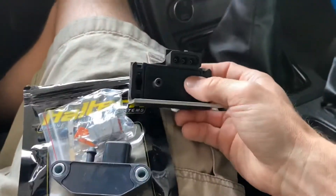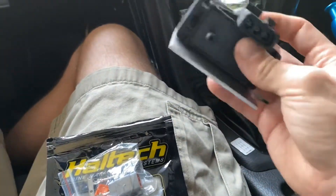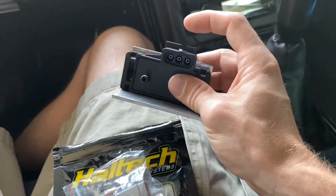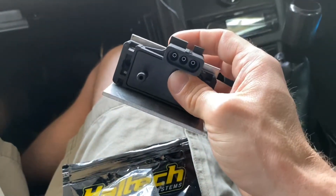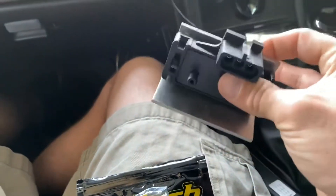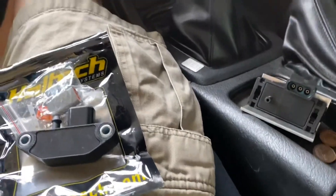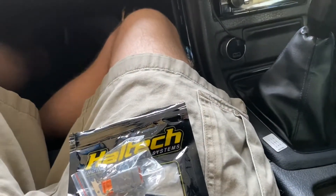What I'm going from is just a standard GM 4-bar MAP sensor. A little bit of backstory on why I'm doing this replacement: since I've gone to the single turbo, we went MAP over MAF, and I had a MAP sensor failure but I couldn't quite figure out that's exactly what it was for a long time. What had happened was I shipped the car from Okinawa up to Aomori Prefecture, and the day I got it off the boat out of the shipping container I had problems with the car starting and not wanting to stay running.